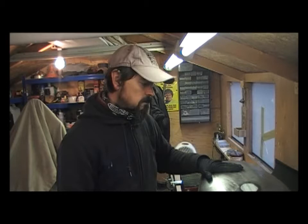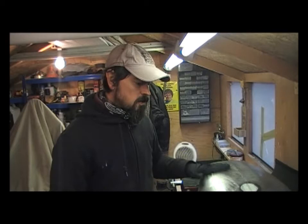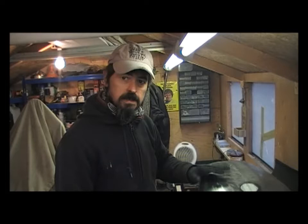It's in raw steel and today what I'm going to be doing is cleaning it all down, degreasing it, sanding it all down with 120, 180, 240 and finally 400, to get it nice and smooth, get the steel all polished up and get it really nice and clean.